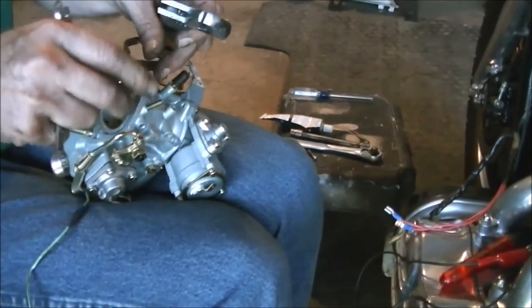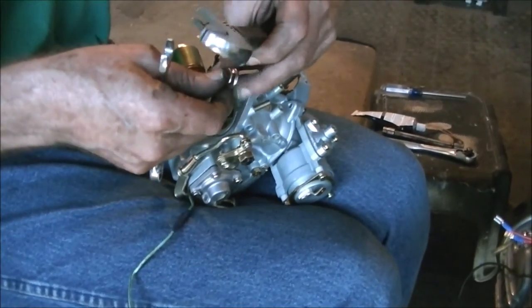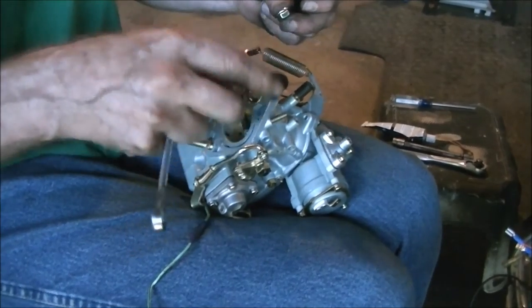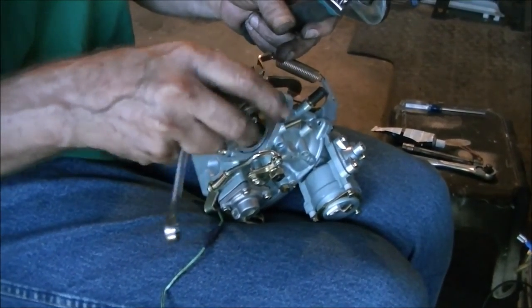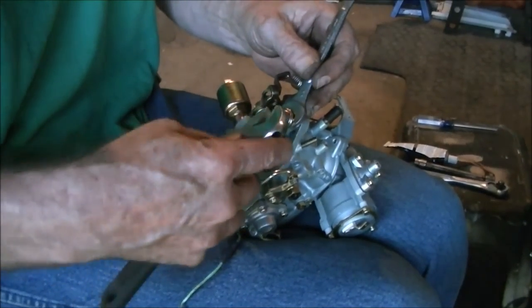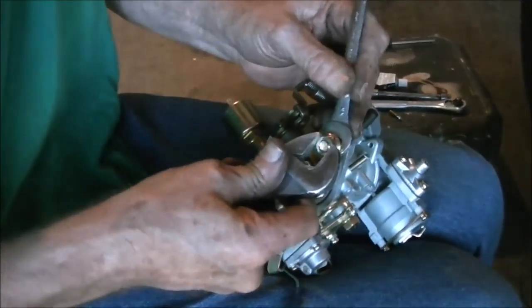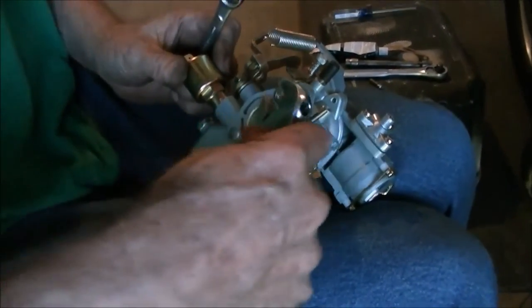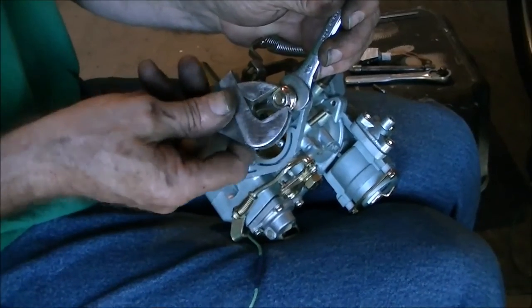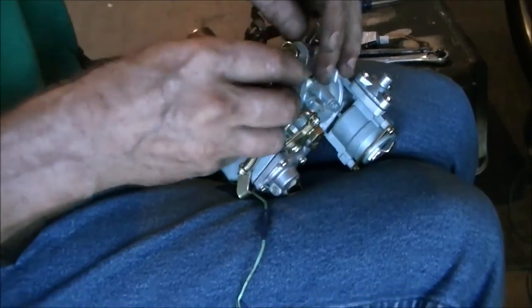All right, let's fix it. Gonna flip this nut over. Or that one. Come on now. Now we can get the wrench and the crescent wrench on these and snugging these 2 nuts up to each other nice and tight. And then I'm going to drive that into the carburetor nice and tight. Put the wrench back on the bottom nut. Hold it secure while I loosen up the top nut. And let's do the same thing to the other side.